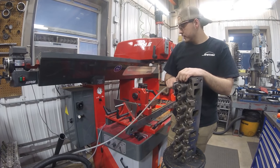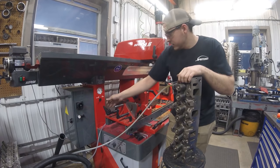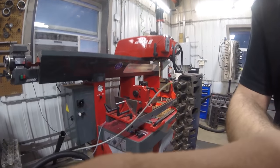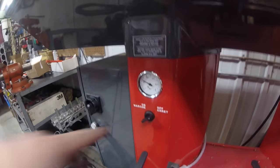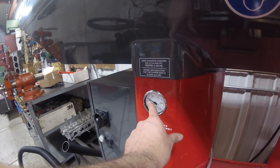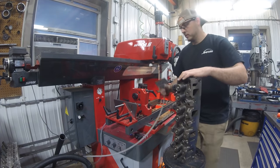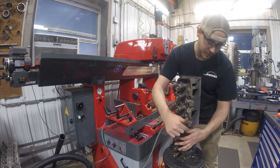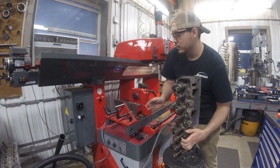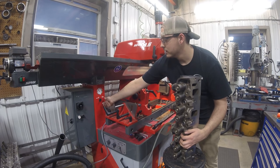Starting with the exhaust - when I turn this off, that gauge is just going to hold. That's absolutely perfect. I've got it here on this exhaust valve and I've turned the vacuum off - that gauge would be going down if it was leaking at all and you can see it's absolutely not leaking. On the next one it leaks down just barely, but I'm assuming it's because it's coming out the crossover passage where my hand is and I don't have a perfect seal on that. If I let it suck the fat of my hand into it, now it's perfect.